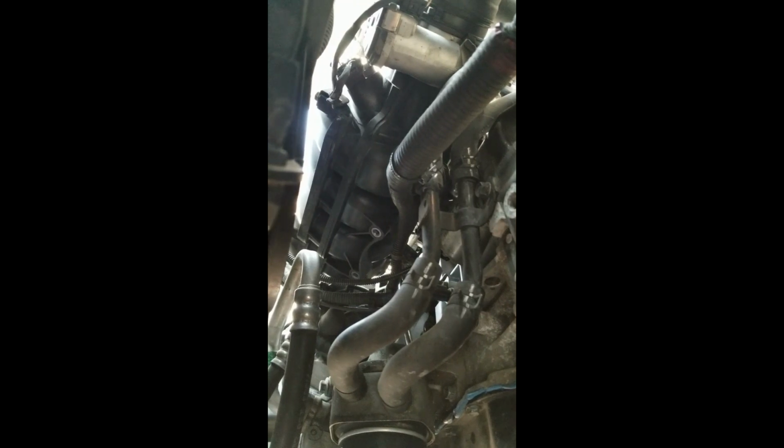So you need to take those loose, and therefore you have to drop the panels. And also, to my joy, one of the starter bolts is accessible from here. And the starter lives right behind there. This is the oil cooler mechanism, and right here are the oil cooler hoses. There's all kinds of stuff that you can't get to at the top starter bolt. Also, the intake manifold is curved down, which is this area right here, and it won't allow you to remove the starter, so you must remove the intake manifold.